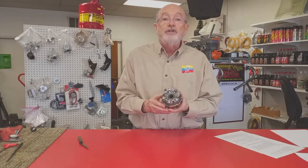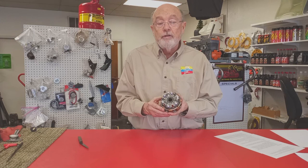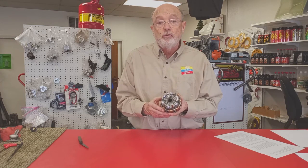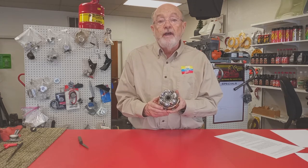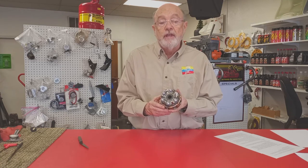When you run the jackshaft clutch for the first time with new discs, it's a good idea to run 3 or 4 slow laps and then come in and let the clutch cool down. That gives a chance for everything to break in and seat in properly. You'll find that as the clutch gets hotter, it bites harder when it engages.